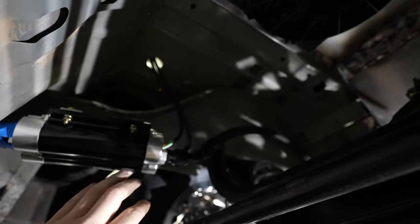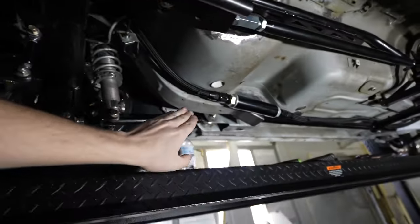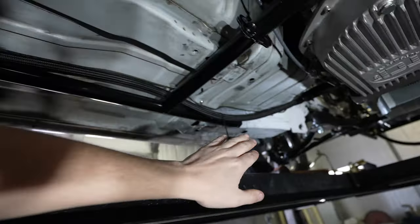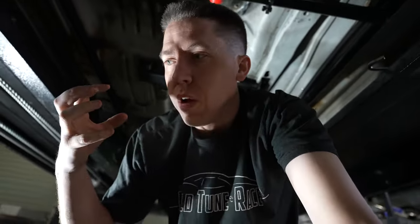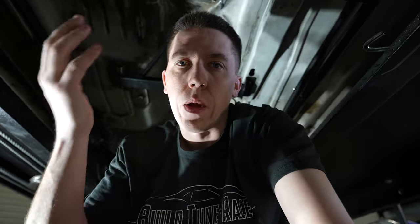Something else I've been working on is running lines. I'm running out of fittings, but I've got the lines ran over here, across to the post filter, down the line, and then up to where we're going to adapt them from one dual-12 to two 12s and run them up to the top. I was going to go to two 12s up in the engine bay, but then you've got a lot of fuel lines in one area, so I'm going to split them right there and carry two fuel lines up to the rails and plumb out the fuel system.